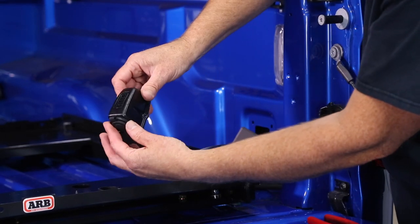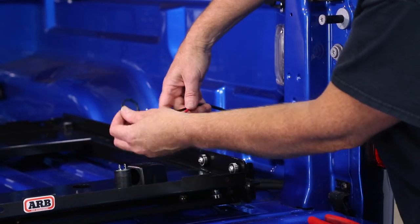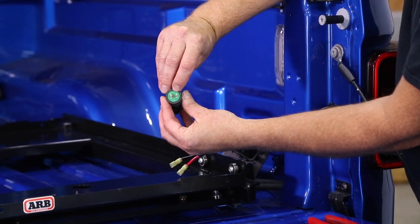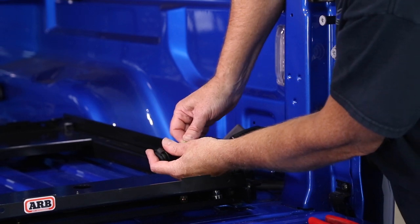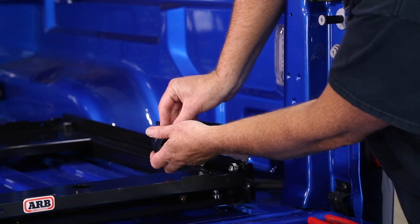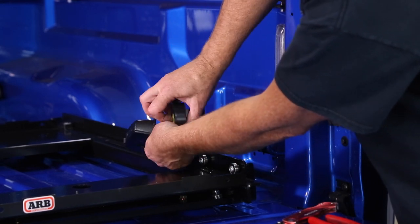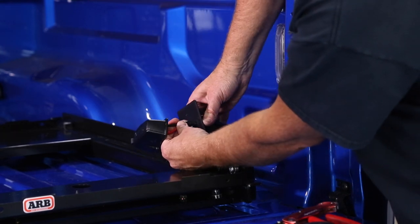Grab your surface mount socket, pull the nut off the back side, and the socket itself will slide out. Throw the nut onto the wiring loom and then the surface mount housing. On the back of the socket you'll see a little tiny plus - that's for the red wire - and a little tiny minus, that's for the black wire. Plug your harness into the proper terminals, then throw that flush mount housing back up there with the nut. Then put a couple loops of black tape around the harness just to help stop it from being pulled through the face plate, put a little bend in it, and we're ready to put our screws back in place.